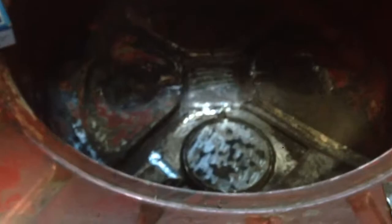Okay, so here's a quick update. I've cut out basically the rot that was sitting in this location here. I've got a replacement panel that I'm going to be putting in. It will fit in just like this, and that'll fix that spot. I'm also going to be cutting out the majority of the metal in this section right here as well. You can see there's some holes there. I still have to cut that out, but I have this replacement piece that I made that I'm going to weld in and set there. The center piece I've already replaced, so that's all solid now. It's a little tight in here, so I'm not really able to film very well when I'm actually working on it, but I'll update you once I've got these pieces welded in.